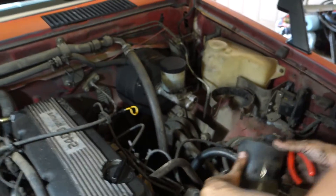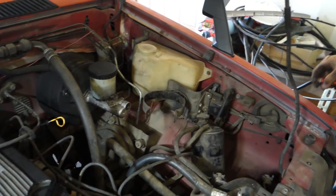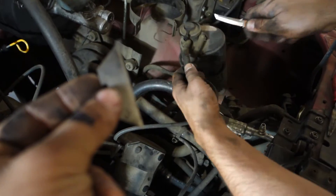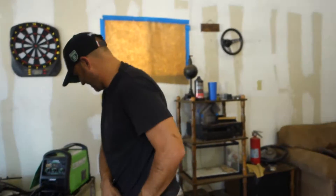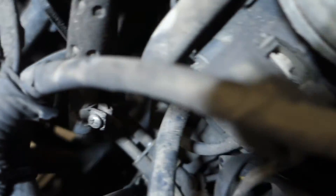That one I just pulled off and then this fat one here — I'm just going to cut it. I'm going to attempt to cut with zero success. My mini katana did it! Alright, so that was this big one here. The big one runs to the throttle body back here — you can't really see it because of this harness, but it goes down in there. And this little one here runs to right here where my finger is. So we'll pull that one off.